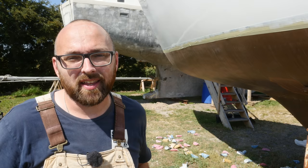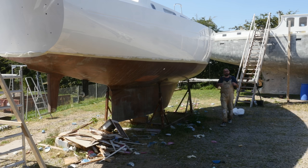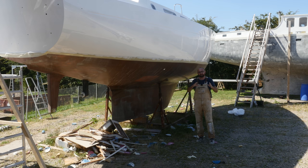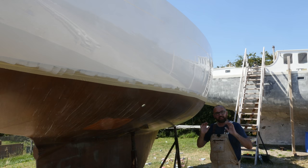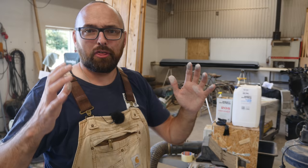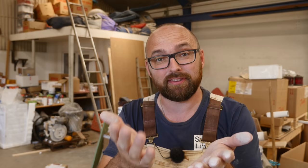It took about an hour and a half to paint the entire hull, and I'm not going to lie — it was redonkulously warm in that suit — but I think the result is worth it. The port side looks a little bit better than the starboard side but I can't really show you the port side right now because of the harsh light. But to me this looks amazing. Keep in mind that this is just applied with a roller — it's not sprayed, it's not even rolled and tipped, it is just a roller. I am thoroughly pleased with that result, and the Perfection Pro goes on really nice once you get the hang of it. I have no doubt that anybody out there with just a little bit of patience will be able to achieve the same result.